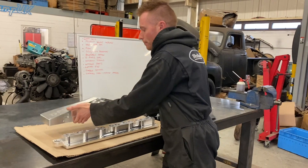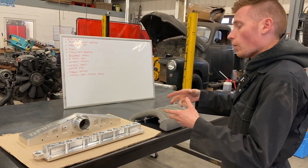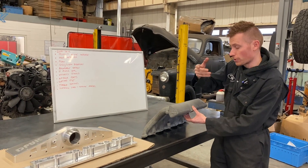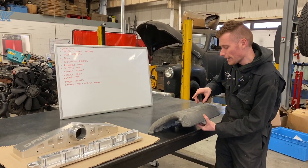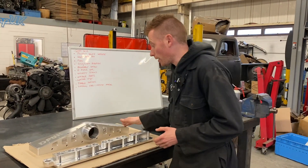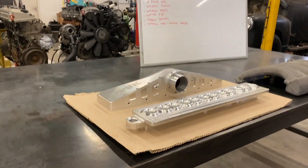Inlet hose diameter: we went from a two and a half inch in the original to a three inch in our upgraded version. We also put a lot of effort into the flow. Leading on from the hose inlet, on the original, when the air comes up into the inlet pressurised from the turbo, it gets shot straight against number three inlet runner — it doesn't have a nice path of flow to the rest of the cylinders. So I wanted to create a path almost with this triangulation, where the air comes in and gets funnelled down into the velocity stacks, which have also given us a nice gain towards the flow.